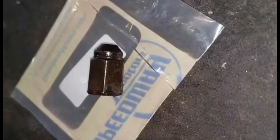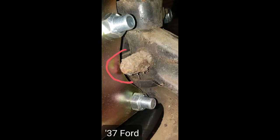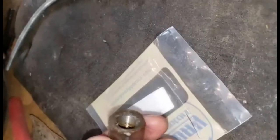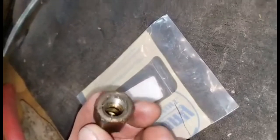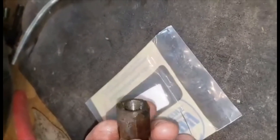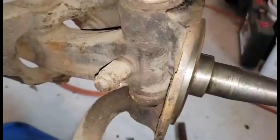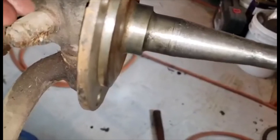Here's the piece that was giving me troubles on my kit. When I installed it, I could turn to the right no problem, but when I go to turn to the left it would hit — this piece would hit the adapter bracket. So it was surprising how easy it came off. I called tech support and they said just put a regular nut on there and it should be fine. The thread on this one is actually 7/16-20 national fine. There it is — the wheel stop. Just got to spray some stuff on it and unscrew it.